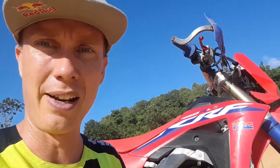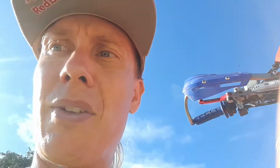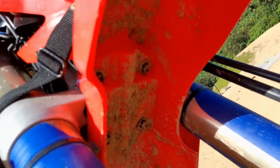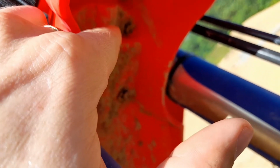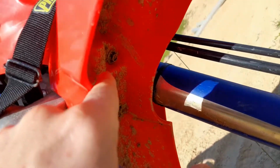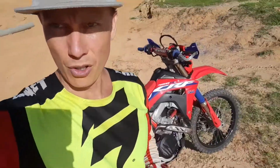character. And I've just been out test riding it, and it's really cool because, I'll just turn the camera around here, the tires don't even scratch on the top here, even if you bottom out. Usually the problem with lowering the bike like this is the tires might make contact with the underside of the fender. And the same thing for back here. It doesn't even make contact under the rear fender. So overall it handles really good for motocross and also enduro with this lowered suspension setting.